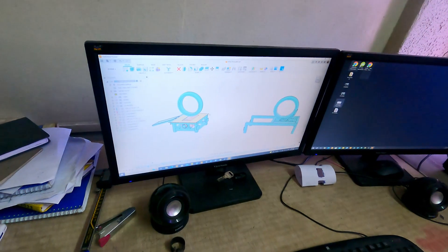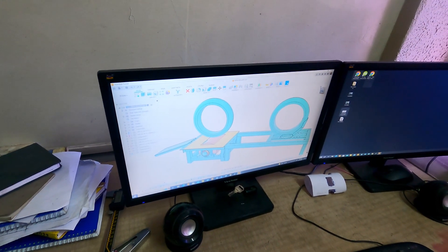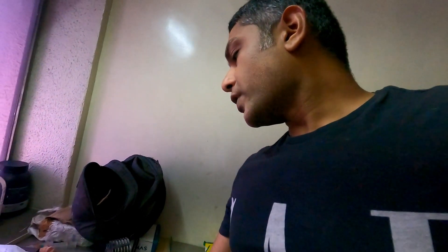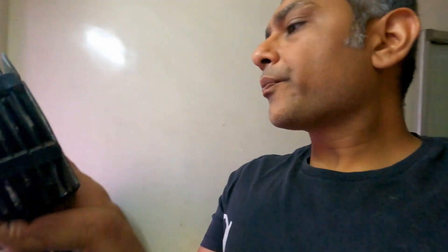We could test a lot of other things — not just two-stroke but also four-stroke. It will give us an opportunity to understand different port maps. Kishan is already working on an AX100 block designed for more than 12,000 RPM — if you can see, the port is huge. So the power comes quite late, but it's a lot of power, somewhat like a MotoGP bike.